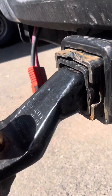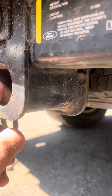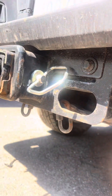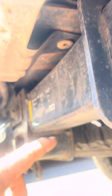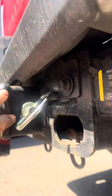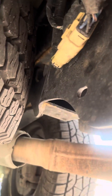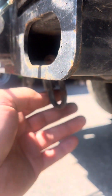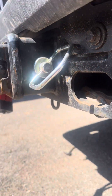Some of you are saying, well that's great on older trucks, but on newer trucks there's just not as much. This is a 350 — I hook my safety chains here, but my breakaway switch, if we look around, we ideally want something off of this main tube because if this hitch were to fail — since these are hollow, they tend to rust out in the middle — you're gonna lose your entire receiver and safety chain mount. We do have some independent points and hooks back on the frame right here, which would be a great spot. I'll admit sometimes I get in a hurry and keep them on the second set of holes — at the very least that's independent, so if these ripped out, you'd still have your breakaway somewhere else.